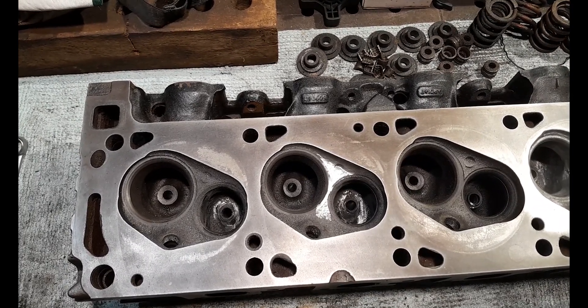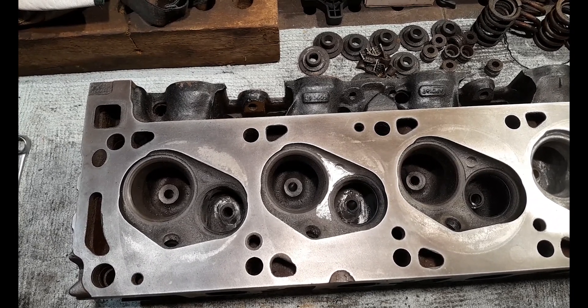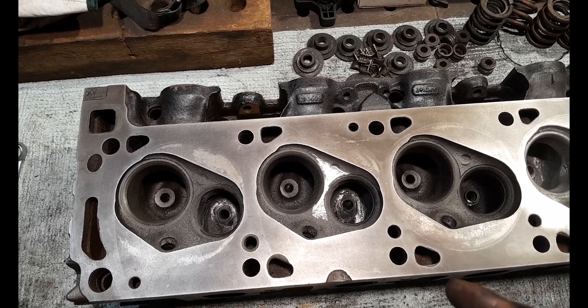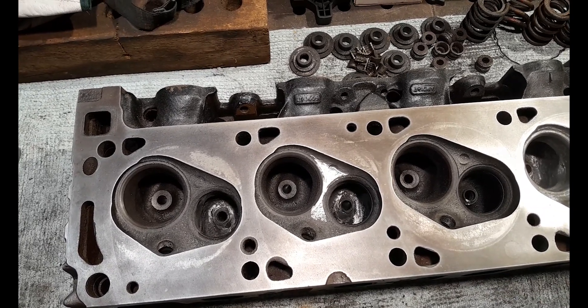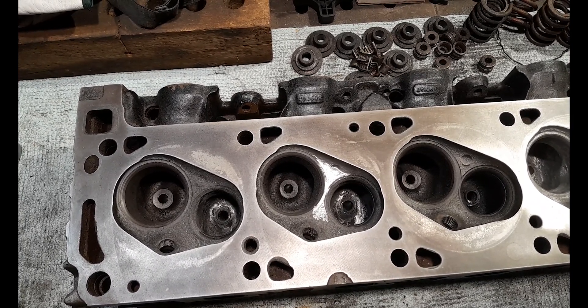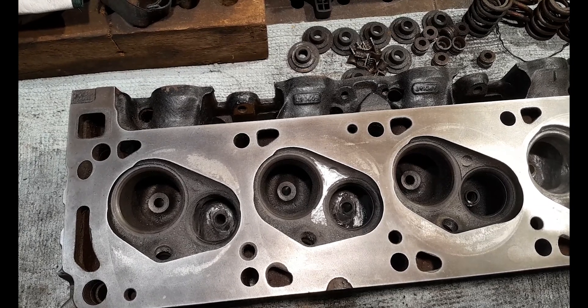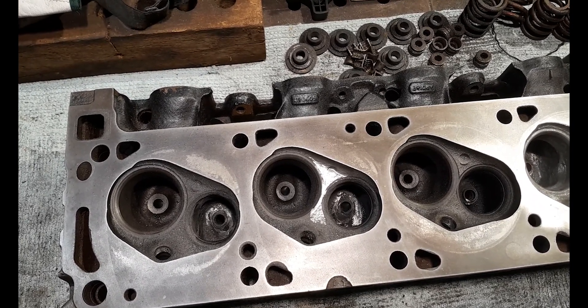You have to try and be consistent with your porting as I mentioned earlier. Because we need to chew off small parts at a time, that's going to be it for today - we'll just do that boss and that's it for now. That'll give me a chance to make that first exhaust boss the same as this one I've just done. We'll be doing smaller, hopefully shorter videos, more detailed on every part. On the next video I'll attack the port and we'll blend the bowl, and I'll take the ridge out at the bottom of the valve seat.